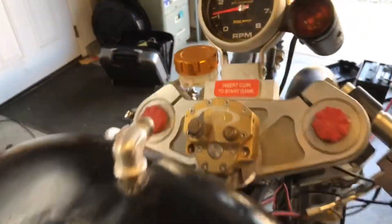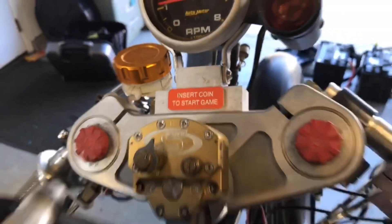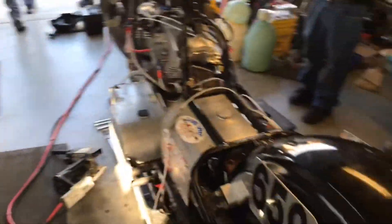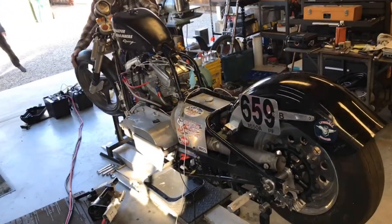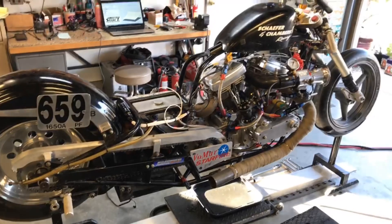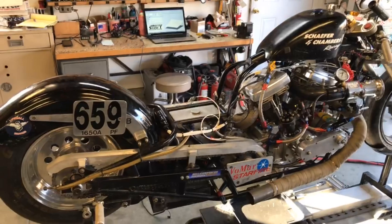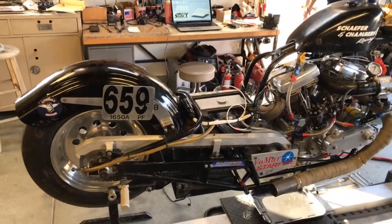Hey, it runs! It even smells like a fuel car in here — awesome. It's one way to smell nitro in January when there are no races and it's COVID. So anyway, it works. The lambda works, no problem, on nitromethane. That was 70%. The mixture's a little bit rich when you transition from gasoline to nitromethane — obviously it has two fuel systems going on and while they're mixing together it's not real happy. But once the lambda restores, you can see it sits right there and idles happily at 0.71 lambda.